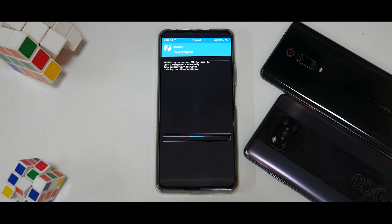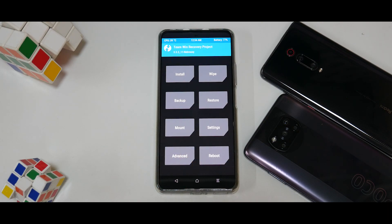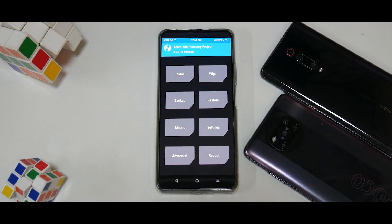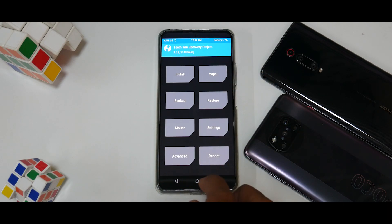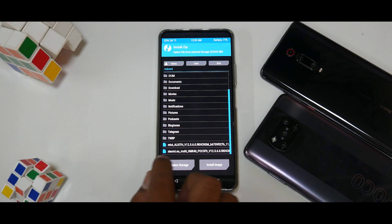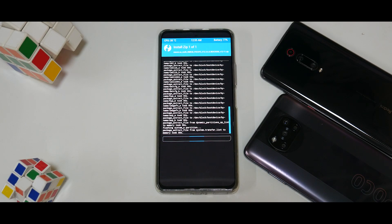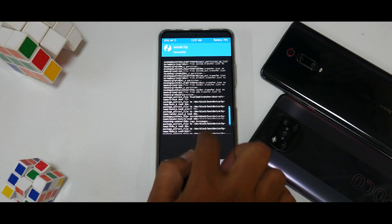If you are encrypted or you don't remove the lock screen password, this is what will happen — that is why I requested you to remove the lock screen password. In recovery, go to Install and select the EU version. You don't need to wipe or do anything — just go ahead and directly flash it regardless of what ROM you are on. Remember this is a MIUI update so it will be anywhere between 2 to 5 gigabytes and it will take some time to flash, so wait patiently. The recovery will confirm everything has been flashed perfectly fine.